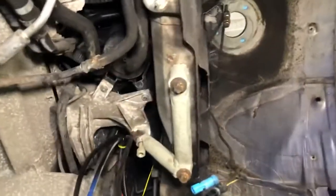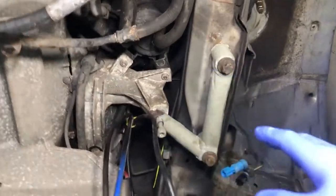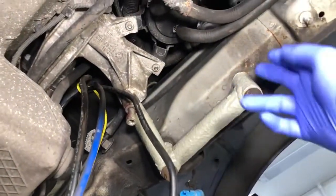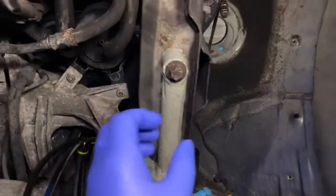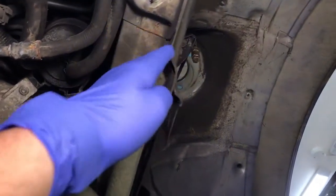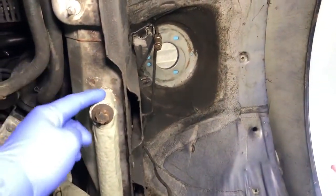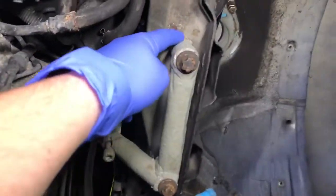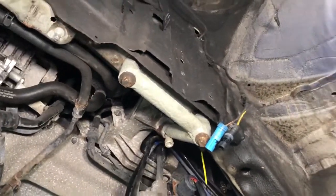We've got our special tools on there, which is what's supporting the engine at the moment. It's a replica of a very small subframe, which is what the engine mounting arms bolt through to, and they load their energy into the OEM bolt locations, which then go into the chassis legs. The fact that then that gives us a very narrow contact patch means we can get to the surface corrosion areas where normally a subframe fitted would hide a lot of that and wouldn't allow us to get into certain crevices. And if there is anything underneath these mounts, then obviously we need to support the engine for a brief amount of time whilst this comes off to tackle anything underneath there. But it gives us much more area to work and make sure that the job can be done to a very thorough standard.